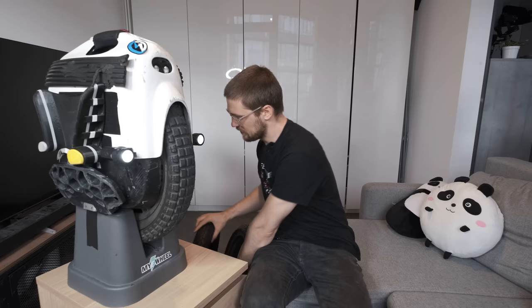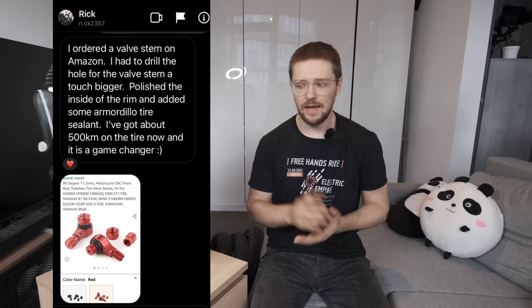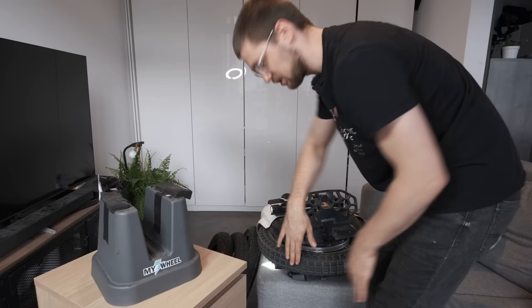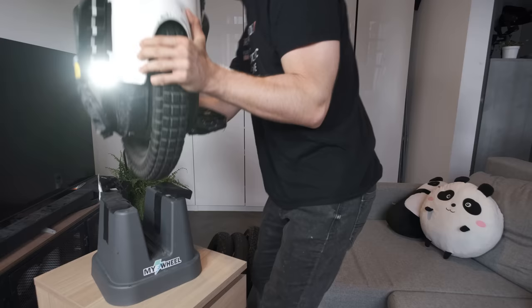I got this info from one of my subscribers on Instagram: you can also make these tires tubeless. All of these EUCs have tube tires, and when fitting a new tire you need to massage it into place — put the wheel on its side at low pressure, turn the wheel, and check if it has any wobbles to ensure it's correctly seated. The tubeless mod apparently makes life a lot easier — you just install a separate valve onto the rim and ensure the rest of the rim is properly sealed. Let me know in the comments if you've done that.